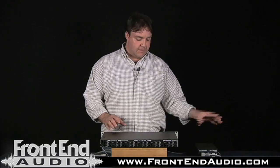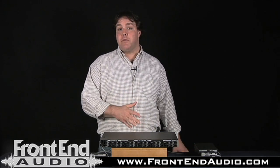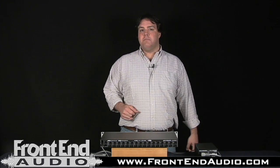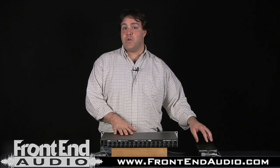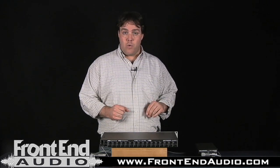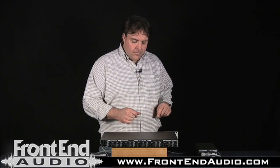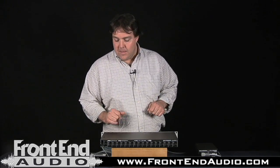Ideally this would be on the floor or on a different shelf at the bottom of the rack, isolated from any other sensitive gear. That keeps any transfer of noise from the transformers and electrical field interference away from other gear. So it really helps out with your noise specs, but also being able to have a large power supply means you're going to have lots of headroom, and headroom is a really good thing in audio.